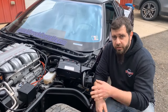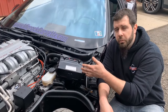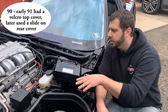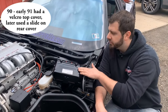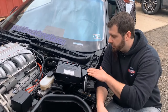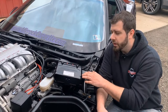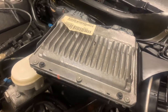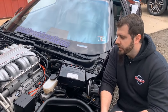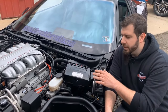One of the other differences in this area is the ECM itself, obviously for controlling the LT5 engine. The ECMs for ZR1s were the same design for 90 to 95, with some internal differences for programming throughout those years. This case design is actually the same that was used on your 90 to 93 base model cars. On 94, 95, and 96 base models, their ECMs changed to an all-aluminum housing with a different bracket design, so the 94 and 95 ZR1s still use the 93 and earlier base model bracket.